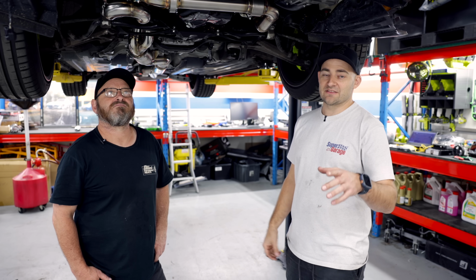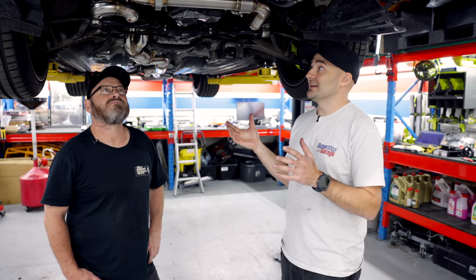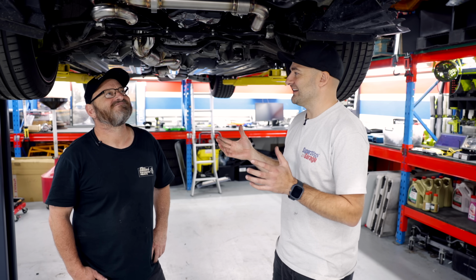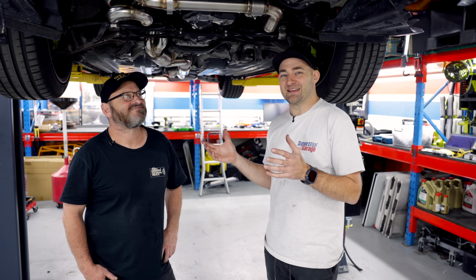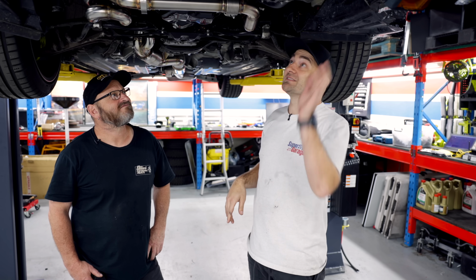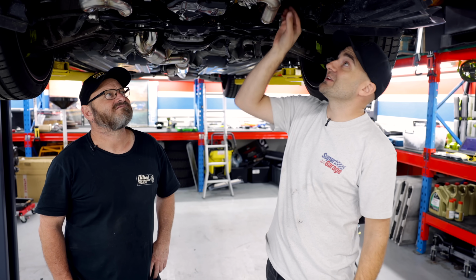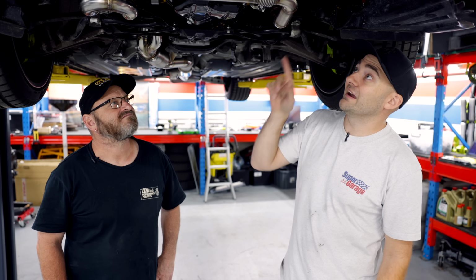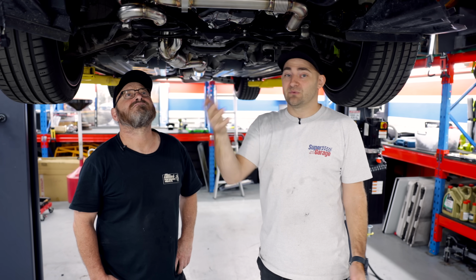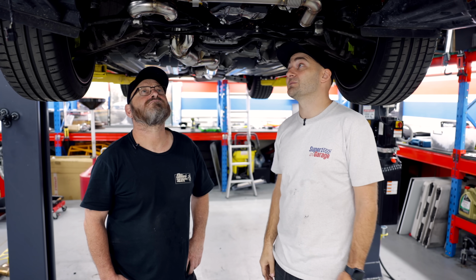You lot may have noticed that the pace is starting to pick up. That's because we're kind of at the last 10% of things right now. I'm going to say 20 or 10% because my fingers are crossed. But a lot of stuff is in place. It looks like there's manifolds, it looks like there's plumbing, but there's little stuff like routing coolant correctly and our oil cooler, which we have to run because there's no room for oil filters here and because we're going to need an oil cooler anyway. Learned that lesson with Supergramps.